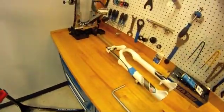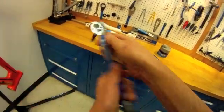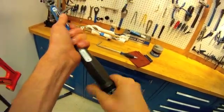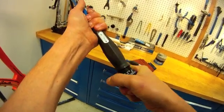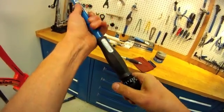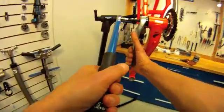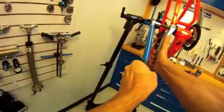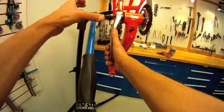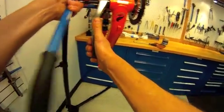We're going to switch to a torque wrench — the TW6. We'll run the indicator up to 44 and then add another newton, for 45 Nm. Then work the two opposing levers: the crank arm being one lever, the torque wrench being another, back and forth. That quick resonation going through the wrench tells me I'm at 45 Nm — that's good.